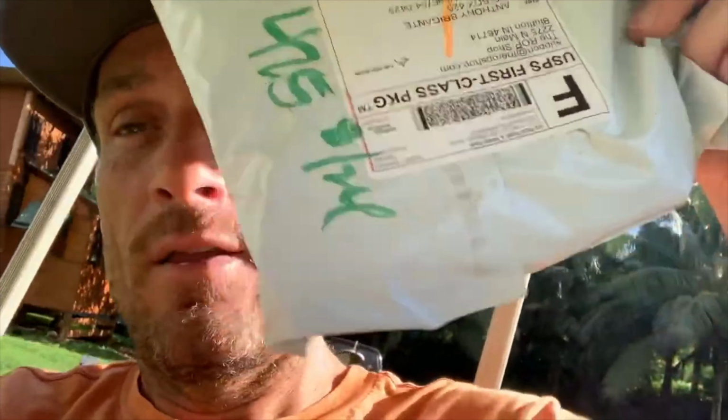So I replaced the fuel pump, the fuel filter, the battery, the air filter, and the spark plug. And it didn't work. So, silly me, I didn't check the throttle cable from the gas pedal to the governor, and it was broken. So let's hope I ordered the right part from Amazon, and we can fix it together, people.